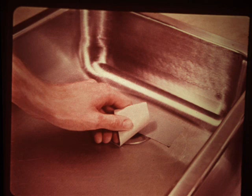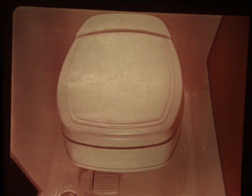Cover these openings with tape if the storage will be in conditions where moisture in the traps could evaporate. And flush the toilet once to get antifreeze into its drain. No more water needs to be added during winter storage.